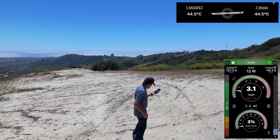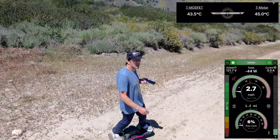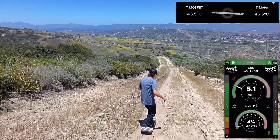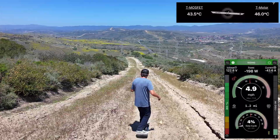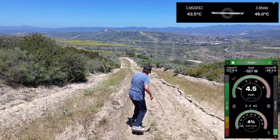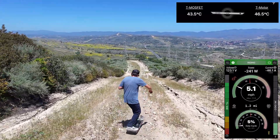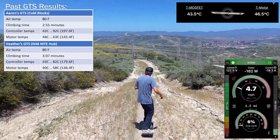We made it up. Look at that — 44.5 degrees. The controller does not stay as cool as a Thor 300, but it stays cool enough that it at least matches the motor, which means it's not the bottleneck. I think the Thor 300 could have done this staying probably below 40. It is a hot day, so it's tricky for any controller. This is actually doing really well. On a GTS, for example, I know I can do it once, but I wouldn't be able to do hill repeats on it.